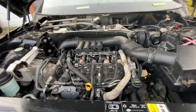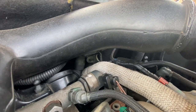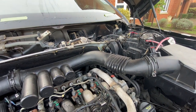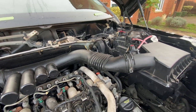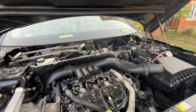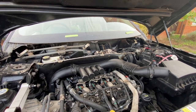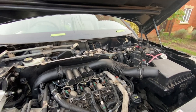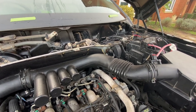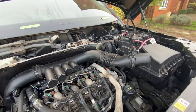Looking at the Land Rover manual, there's a lifting eye tucked in down the back on the edge of the engine block. The idea is you hang the engine from that lifting eye, which allows you to remove the hanger support off the gearbox. I've had a piece of steel fabricated to span the width of my engine bay and bear onto the strut mountings, with hanger bolts to pick up the lifting eye. It looks like I may have to remove the metal panel at the back of the engine bay as it may foul the lifting eye.